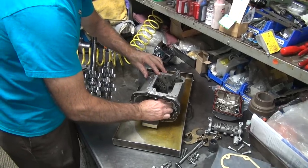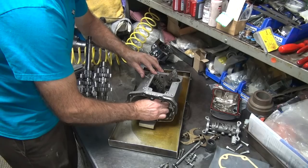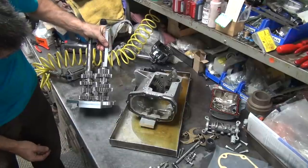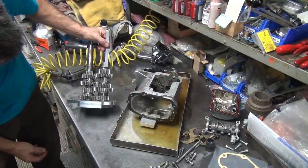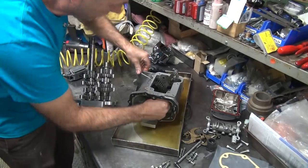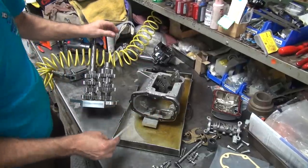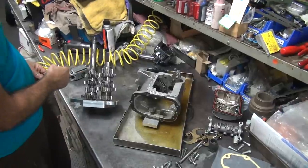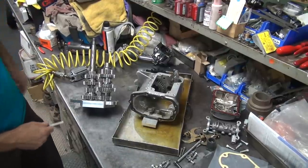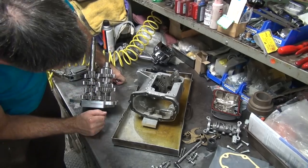Next thing is, are they touching this thing? Yeah, it's probably a good thing you don't touch anything. Okay, this appears to be about 800 to the edge of the case. This is at 750. Should be enough clearance that way. So I think the shaft is cut down enough. It's close, but I think the whole problem is the whole thing is stuck in farther than it's supposed to be.